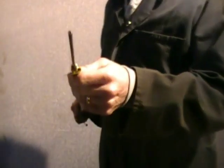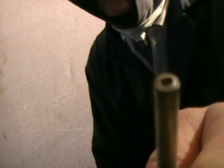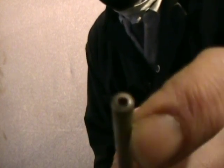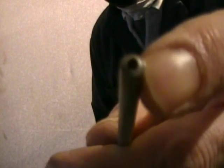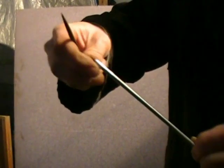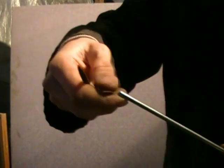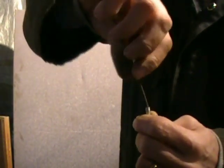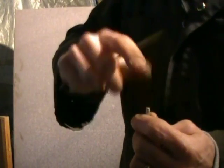What you end up with is a rough edge on this tip here. There's a bit of burring on the inside of it, so I'm going to have to clean that off, and a little bit of burring around the outside that I'll have to clean off as well. I turned it around and tried to get that little burr off the edge, then went ahead and flattened this tip out so it was nice and flat with no grooving inside the hole.